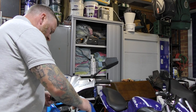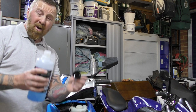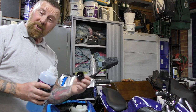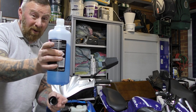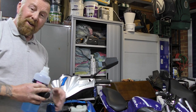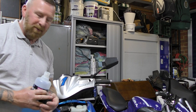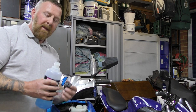Always remember when you're dealing with a water-cooled motorbike or moped, always check the water. This was low — had a service but it was still low, which is quite a lot really. Pour it in, pump it through, start the bike up, make sure it goes through. Forgetting that can cause head problems. It's a five second job — you must do it.